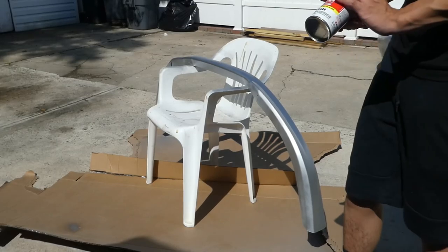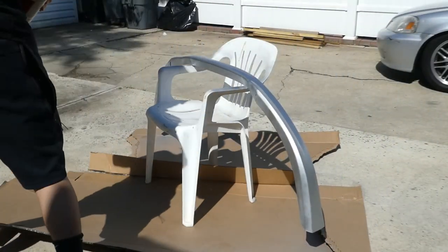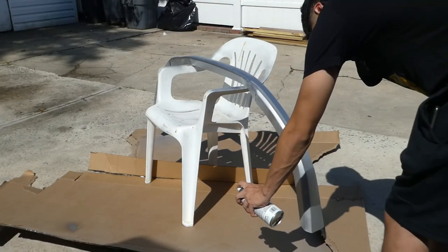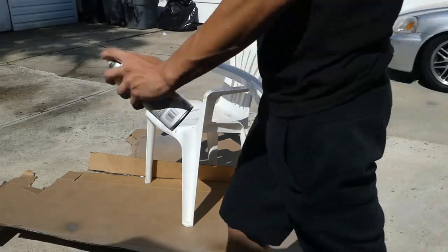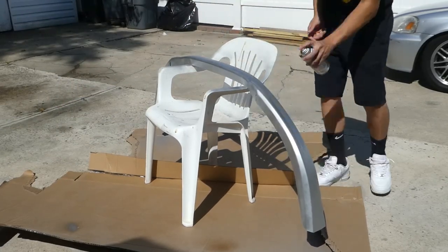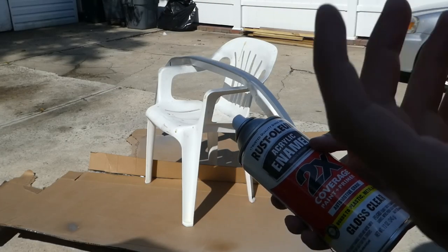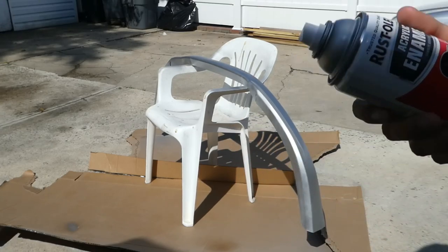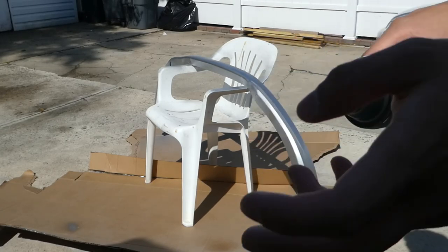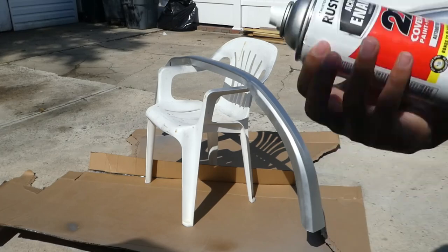Alright, so I hit it with a layer of paint, now I'm gonna start with the clear coat. One thing I hate about clear coat is if you spray too much, it's gonna start dripping. Then you have to re-sand it, cause it's not gonna go away if you keep hitting it with more clear coat — it's a tedious process. So I just wanna do it a little bit at a time and build up on it over time. I'm gonna do a little bit, let it dry, and then hit it with a second layer.